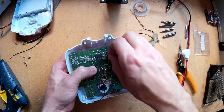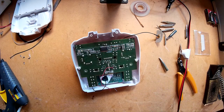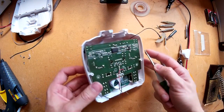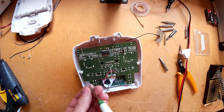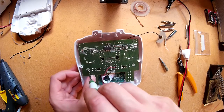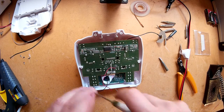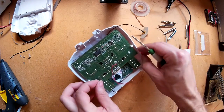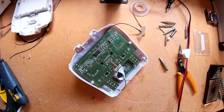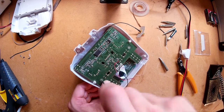I'm just reassembling this now. One thing I've found is not to tighten those screws up too tight, because if you do it presses the front trims. If you find when you turn it on it's continuously beeping, that's what's happening — these need to be loosened up a bit.